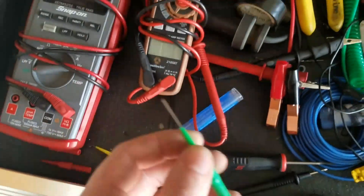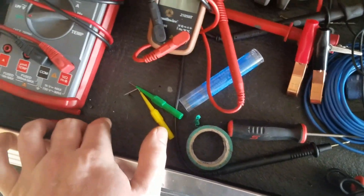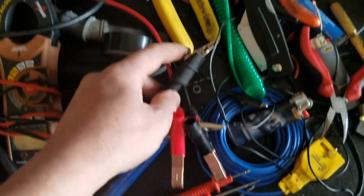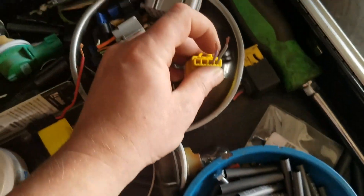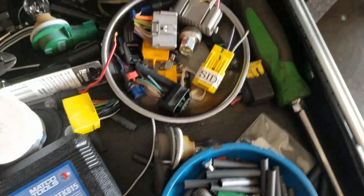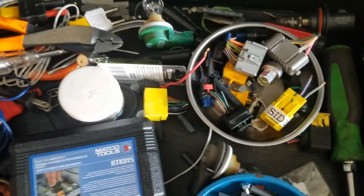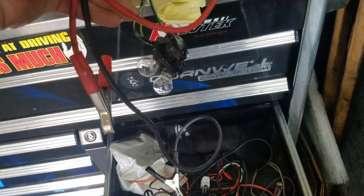Test lead adapters — these ones are needle sharp, and yes, I have poked myself with these. We've got straight ones, angled ones, and bent ones. On meters like my Snap-on, the alligator clip unscrews and you can screw these adapters on to back-probe behind a connector. You never ever want to pierce a wire for testing — it'll corrode. If you absolutely have to do that, you need to cover it with electrical tape or liquid electrical tape.